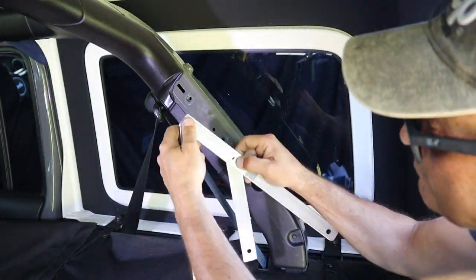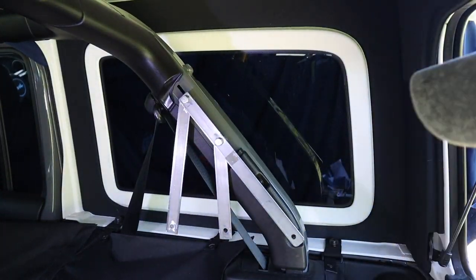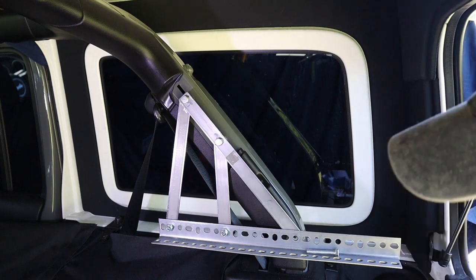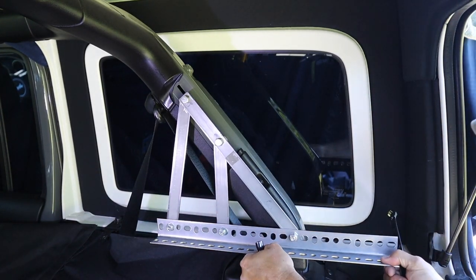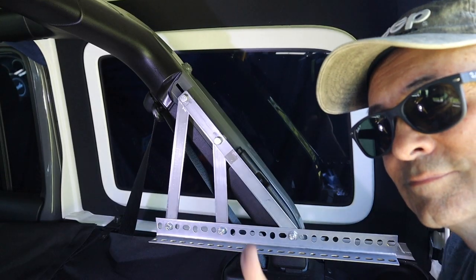Here's a shot showing the spacers and the angle bracket. And now we'll watch the procedure to finish up on the other side. I decided that the bolts should be turned around so that the nuts are facing the outside part of the bracket. The three locations of those bolts are at the second hole, the eighth hole, and the sixteenth hole from the forward edge. If you change your dimensions so that your shelf is located differently, you'll have to figure out which holes will make it level. And now the job is done.